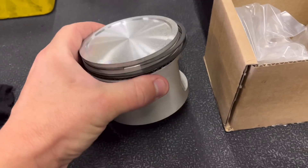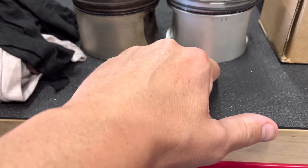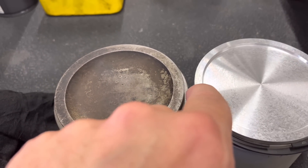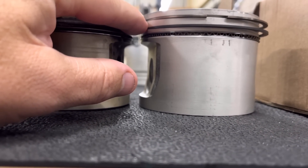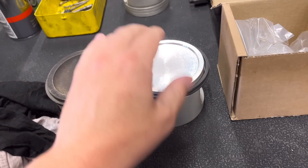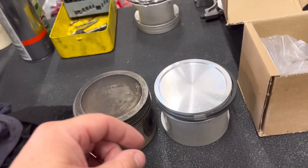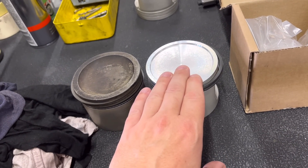Here's one I've already done — comparing it to the original, they stand the same height, pin to bottom and pin to top. I've taken 5mm out of the bowl. The piston ring groove is about 3mm deep, so we certainly don't want to come out as far as the groove, as that creates a weak area. I've got a formula and a program on my computer where I input the dimensions, areas, and volumes to calculate the compression ratio.